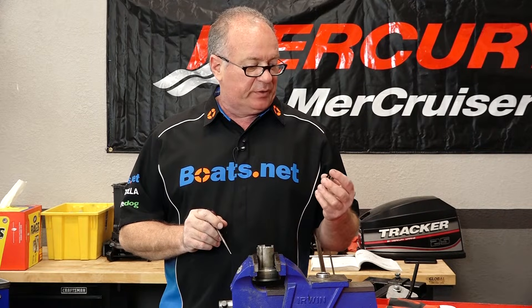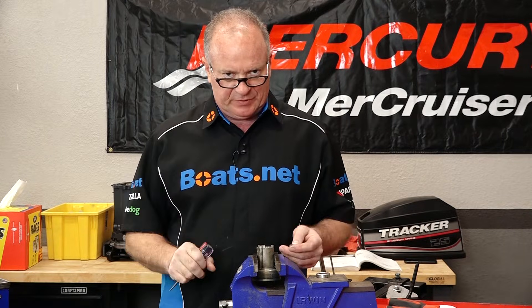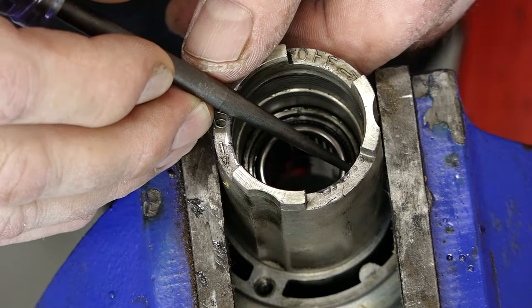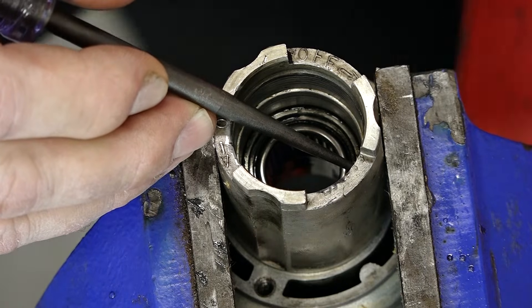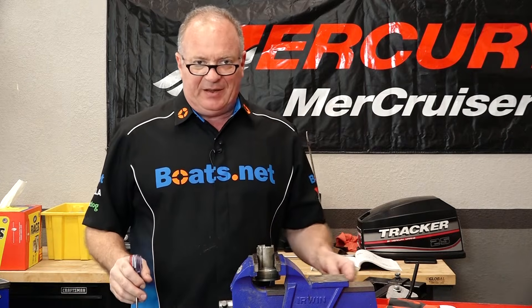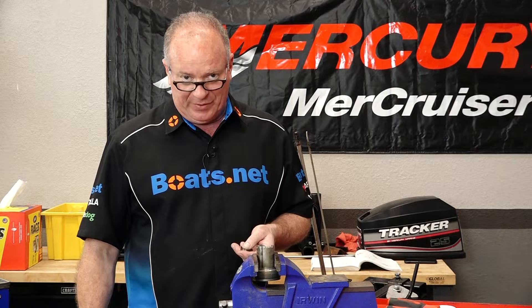We're going to go ahead and drive in our new seals. We're going to put a little bit of Loctite around the outer edges and then drive them into the housing. Now here's the real trick — we're not going to use the little special tool where it automatically sets the depth. What we're going to be after is: on the inner one, 22 millimeters or 7/8 of an inch in, basically an eighth of an inch beyond the lower edge. For your outer one, it's just going to be 10 millimeters in, roughly the same distance inside of the upper lip. Does it have to be dead on? No, but it needs to be pretty close, so take your time. Otherwise you're going to have to pry out your seal, buy a new one, and try again.